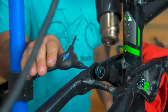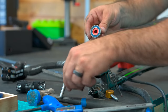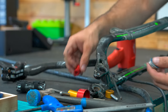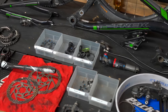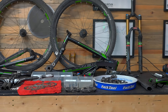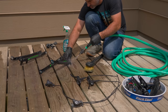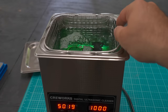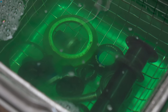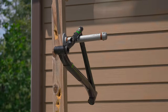Got it. I know who's getting this bike — it's the daughter of a family friend. She's only five feet tall, so a small adult bike with 26-inch wheels is actually a pretty good fit. There's nothing wrong with this bike that I can't repair. The whole bike is apart now, so I have to clean everything — the drivetrain parts, the nuts, bolts, suspension — get all the dirt off, and then we're going to get into the hairy stuff: servicing the suspension, putting the linkage back together, and pressing new bearings in there.